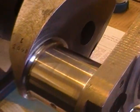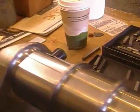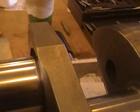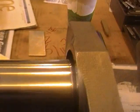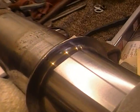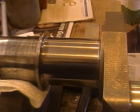The crankshaft itself is a very large unit, four cylinder, and runs a large supercharger off the nose. Here you have the thrust face which becomes very critical for how the crankshaft sits, with this being a bearing surface and this being a bearing surface as well. If this distance isn't set up correctly the crankshaft can go back and forth too far in the engine.